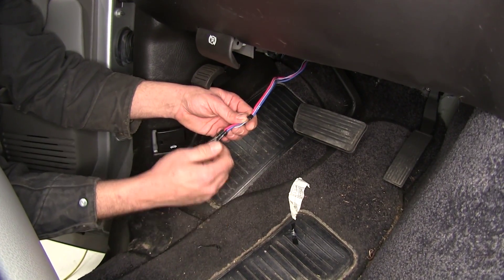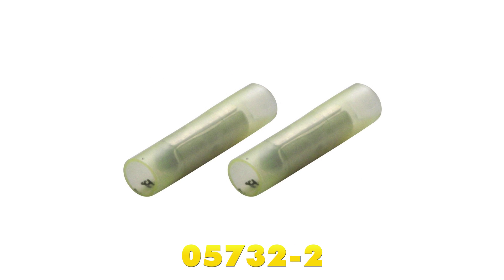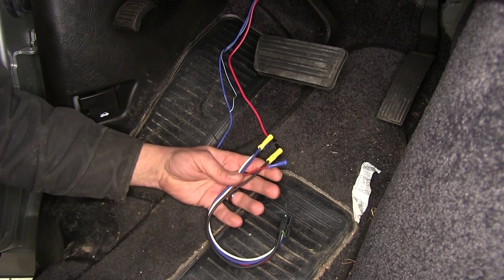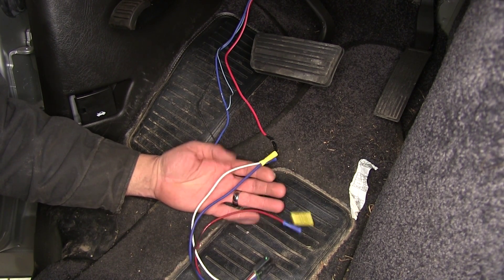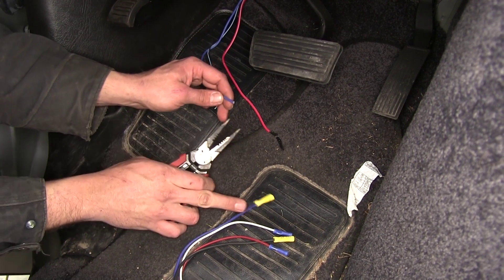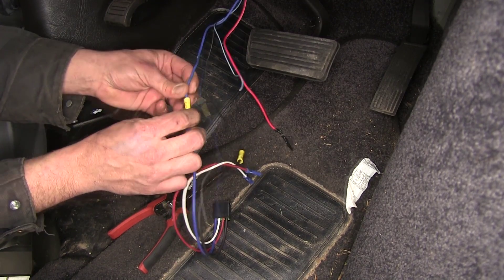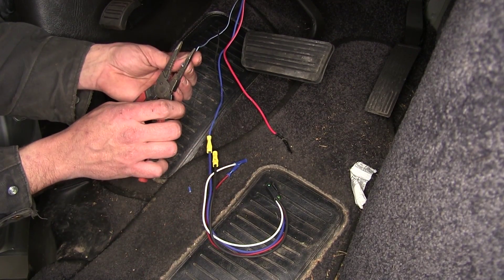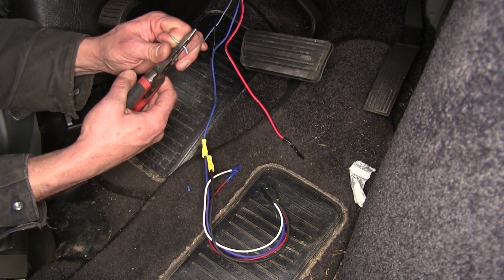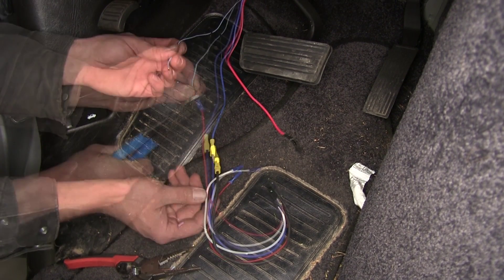To help out with our install, we're going to be using two of part number DW05714 — that's our 16 to 14 gauge butt connector — and one of part number 05732-2, the 12 to 10 gauge butt connector, which comes as a quantity of two. We've connected our butt connectors to the ends of our wiring, so we'll start making our connections. The dark blue needs to go to our trailer brake line — that's the dark blue coming from our pigtail. Our red needs to go to our brake light switch, which is the light blue with white. I'm going to strip that back just a little bit longer and double that wire up to give us plenty to grab onto, then connect that to our red wire.